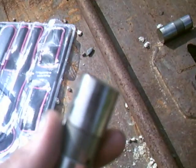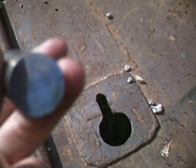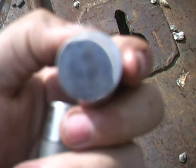Normally when you buy a new cam — a camshaft — you want to buy new lifters for it. You don't want to use the old ones, because even though they look good like this, they have the wear marks from that cam. These actually sit there and spin around and get like circle kind of grooves in them.